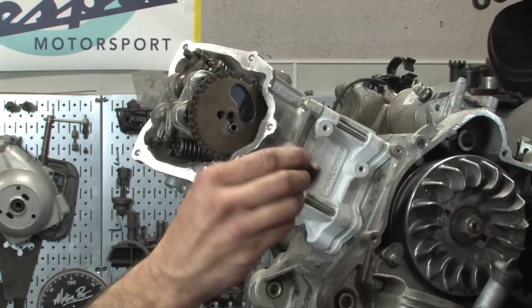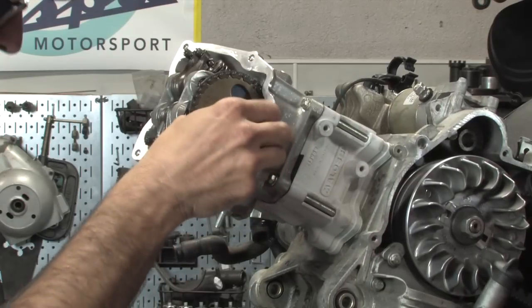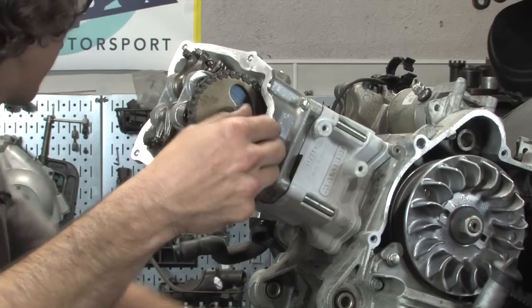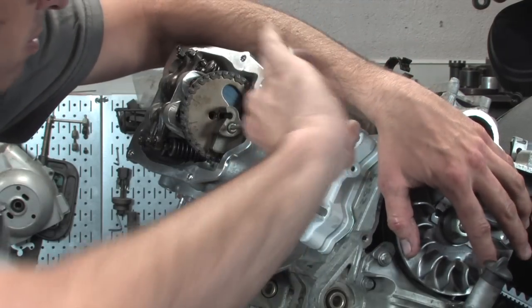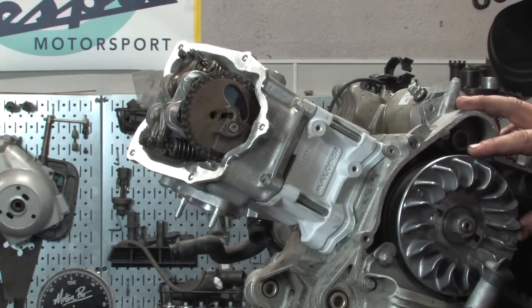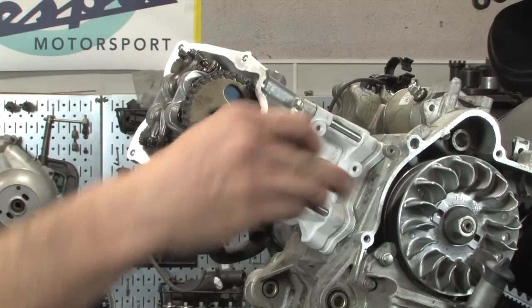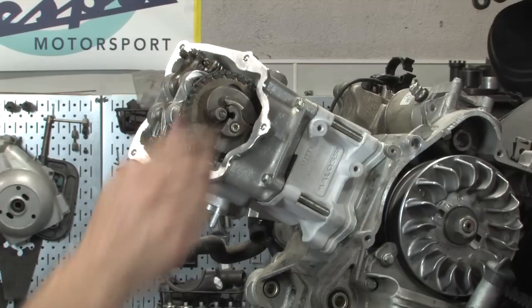The little counterweight, you see it's got the little well right here. Got the screw, that's that screw that was difficult. Like I said, good idea to replace them. And I got just that little hand Allen, it doesn't need to be cranked. Yeah, that's all it needs. It doesn't need to be really torqued on. Then you got the counterweight. You'd put a little assembly lube on this little shaft, and then same with the little nylon spacer we're replacing. It was a little melted. A new one actually snaps on and kind of wants to stay. The old ones are a little bit loose, so they kind of want to fall off. I'm putting a new one on there. And drop that right on.